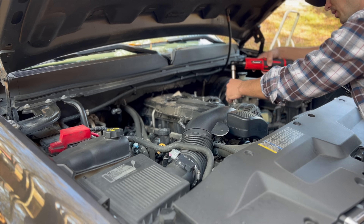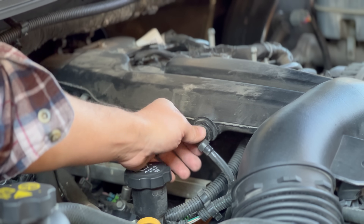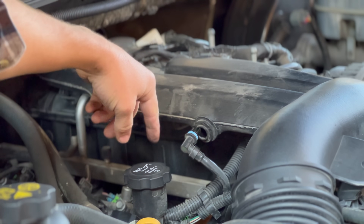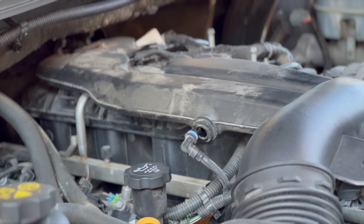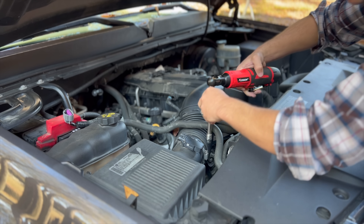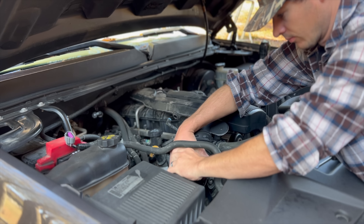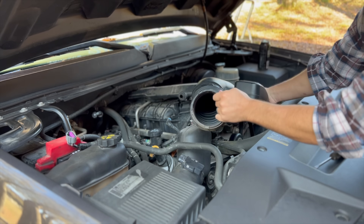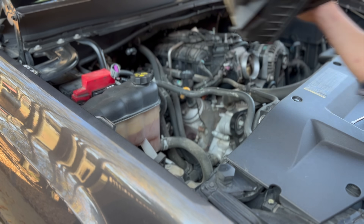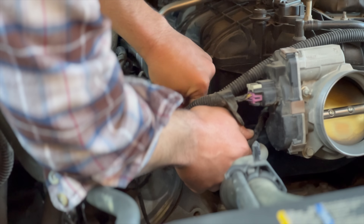There's only one 8mm coupler holding this thing on — the rest we can just pop free. We'll remove our crankcase ventilation hose, gently pull it out, pop it free. We'll have to disconnect it down there but we'll wait till we get all this other stuff out of the way. Let's go ahead and disconnect our MAF sensor so we can get this out. Once we remove everything just for the sake of making it easier, I'm gonna go ahead and remove this one as well. Your air box just pops straight up and lift it out.